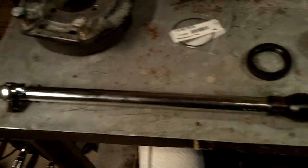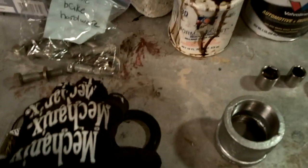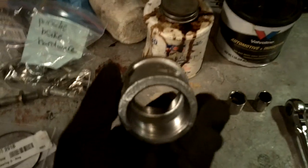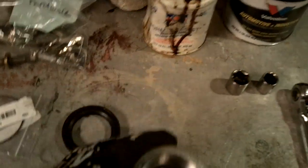We've got a torque wrench for torquing down the bolts. We've also got a bearing seal — I'm going to be putting this inside the hub. In order to help us do that, we've got this cheap little pipe piece. I went down to Orchard Supply; you can get this at a hardware store. It's the cheapest one and a half inch pipe I could find. Basically it fits right over the bearing so we can press it down into the hub. Super simple.